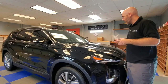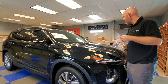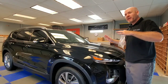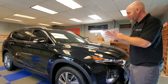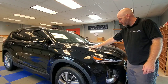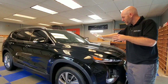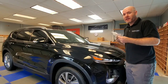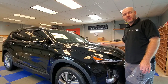We're going to go ahead and clay bar the Santa Fe. A clay bar is just that — a piece of organic clay used to remove contaminants from the paint. Sometimes people have a car they've had for a couple months or years and the paint isn't slick or smooth anymore. That's most often because you have bonded contaminants on the surface. The simplest way to check is to put a plastic baggie over your fingers and gently move them over the paint — the plastic magnifies anything on the surface. You'll feel little bumps like sandpaper if there is contamination present.